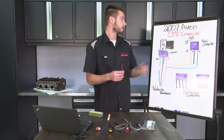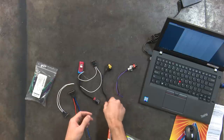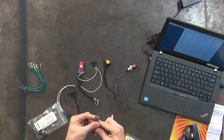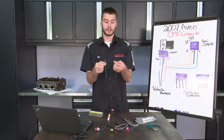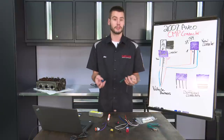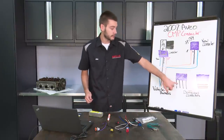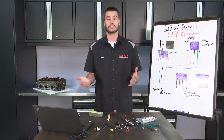Now that is just one example for an 07 Aveo with a 789 connector. They're not always going to be that way. You sometimes will get all white wires or all black wires, or you order up this common Dodge connector and you'll get a whole bag full of wires. You can see we have green and we have purple with very different wire thickness. Depending on what you're replacing, you're going to pin the connector accordingly. The connector comes empty - you're going to pin it according to whatever you're replacing, because this connector fits on multiple vehicles and multiple makes for multiple different uses. So if it's a high current flow, high amperage circuit, obviously you're going to use the thicker wire. The moral of the story is to not trust the wire color. Always go off of orientation.